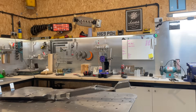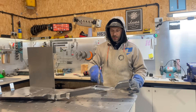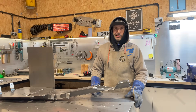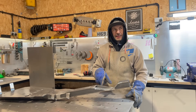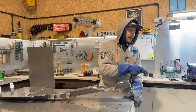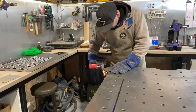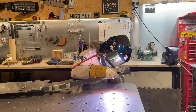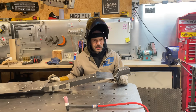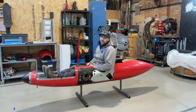Now it's on the bench, let's mark this out and chop it out. One big hole. Now I want to take some 2.5mm steel plate, cut a piece out for my feet to sit on, and weld it in. I might cut this piece out, tack it on, pull it back in, and then see what it looks like — there's going to be a lot of in and out. There we go — just got to weld that to that. That's tacked on; better try it out before guessing the next bit.